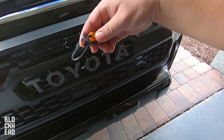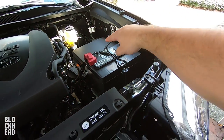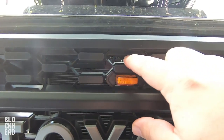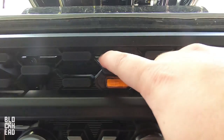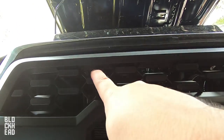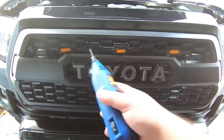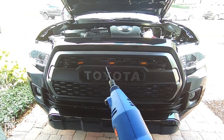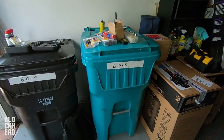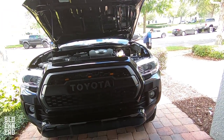So these raptor lights go in the grill like that and then pop in, and then we've got to wire them up through the back into the fuse box. In keeping it true to raptor fashion, we want them on the top row, not the lower row. But in the TRD Pro grill there's a little piece that keeps them from fitting, so we have to dremel that piece out on a few spots. If you're interested in these, I'll drop a link in the description below to everything — the lights, the add-a-fuse, wire strippers, even the dremel.